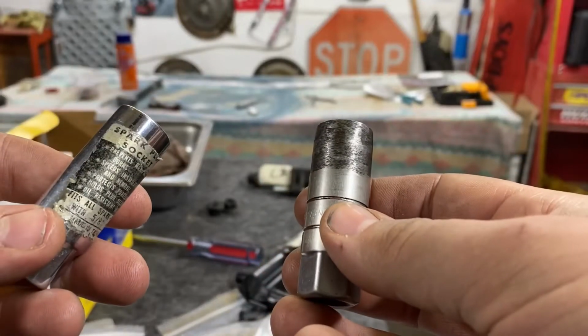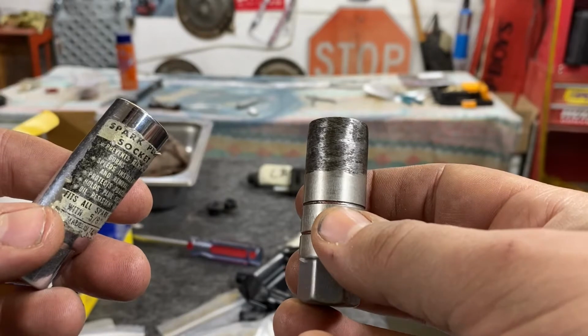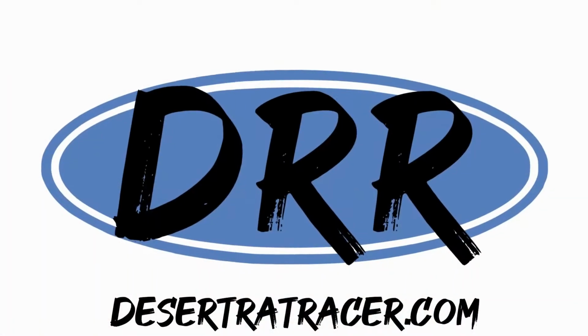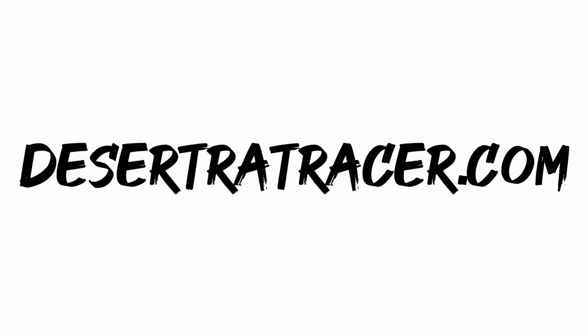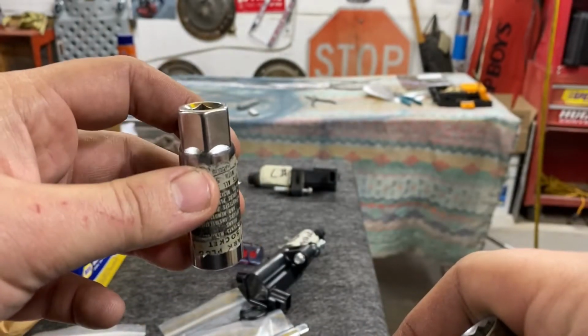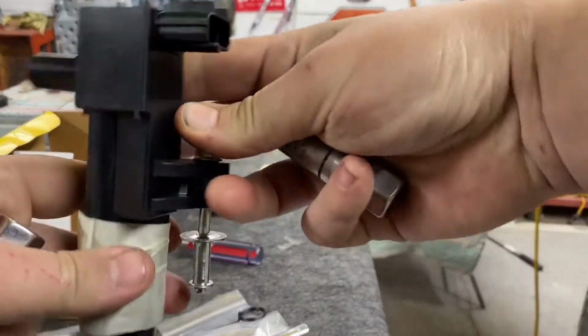Okay, so I wanted to talk about a few points about changing the spark plugs in a 2009 Jeep Grand Cherokee with the 4.7 V8 engine. It has two rows of spark plugs. It has one set of spark plugs that goes in the top by the intake manifold right under the coil pack. And then the coil pack has a second wire that comes down like this one.